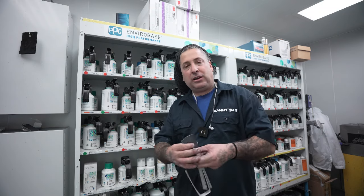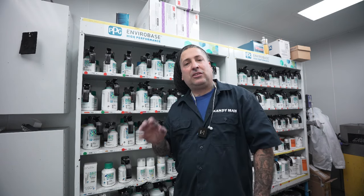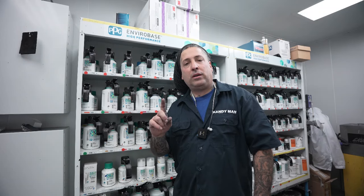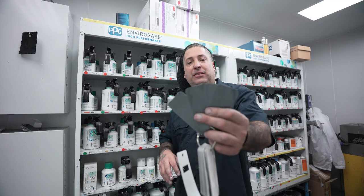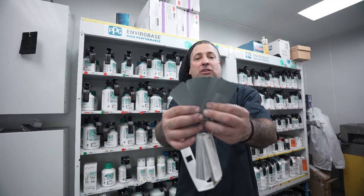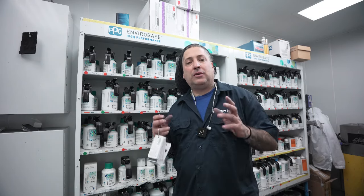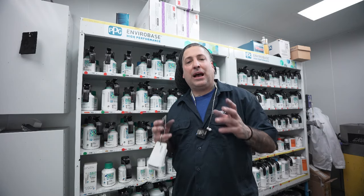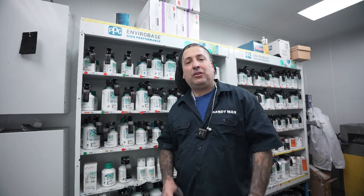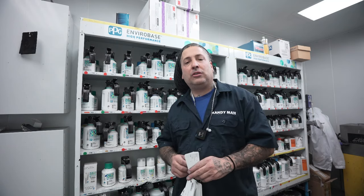So there are chips for that color. Even though that is a standard Mercedes color, there is variance for each color that you mix. There's not just one, and it matches the car. So with this one here, we've got 5 different variants for that color, as well as some specials that PPG has that are from out in the field of us painters that had trouble, and we verified that color, we got it right, and we've sent it in to the lab, and now they have specials for it. So let's go ahead and check the color to the vehicle.